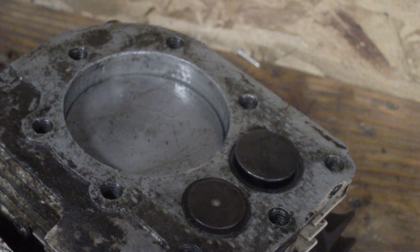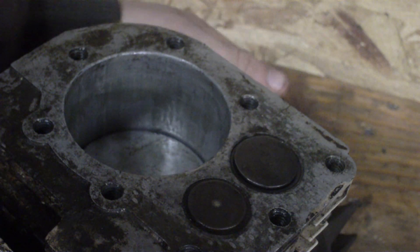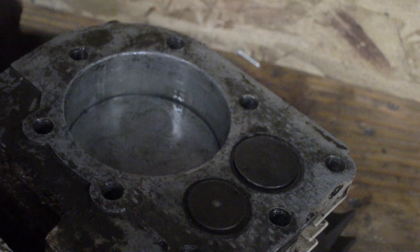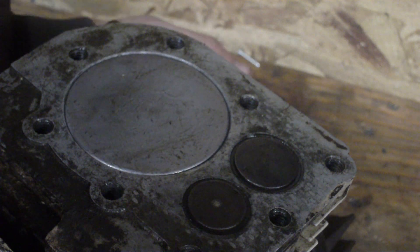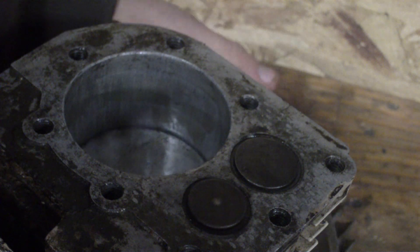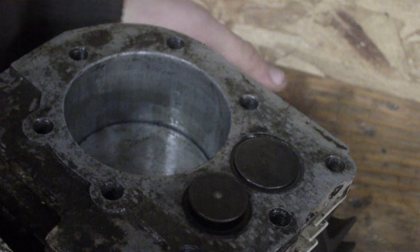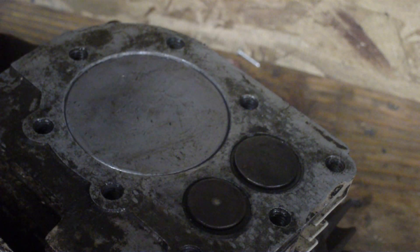Let's go through it again. It's your intake — the piston is sucking in the mixture of air and gas. This is your compression stroke, compressing the mixture. This is your power stroke, where your spark plug fires, forcing the piston back down. Then your exhaust stroke — as the piston comes up, the exhaust valve opens, allowing all your burnt gases out of the engine. That's your four strokes.